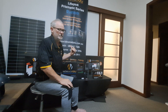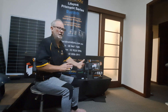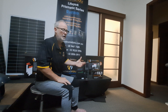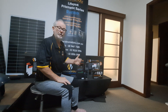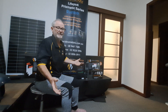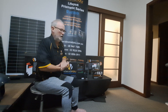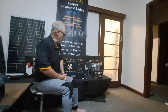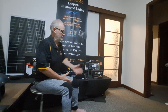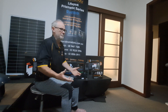The 10 amp charger is quite sufficient for charging overnight. Never with any battery system leave the batteries on charge when they're fully charged — there's no point leaving them on charge consistently for months on end. A lot of people put them in the garage and leave the charger on them. Charge them up and then every six months just charge them up again — that's all the maintenance required. They do like to be run consistently, so cycle them continually if you want. You'd expect around 3000 plus cycles, so three to five years at least. The V5 we're still seeing around after five plus years.